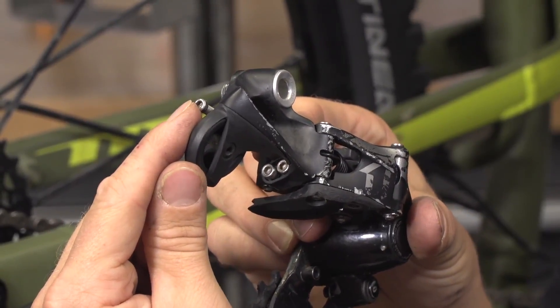BMEC 8691 is planning to switch from 53/39 with an 11-23 to 50/34 with an 11-28 and asks whether their Shimano 7800 Dura-Ace rear mech will work. Shimano states a 27-tooth maximum, but I have it on good authority that it will work — I know someone who got a 28 working fine. Once you've fitted that 28-tooth cassette, check that your upper pulley wheel is far enough away from it. You'll probably need to turn the B-tension screw a little to drop it down.